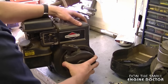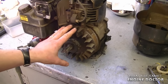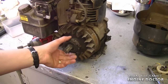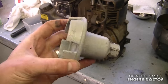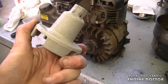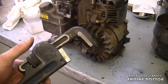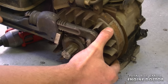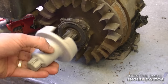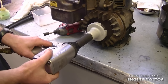Now the recoil should come off. The next thing that needs to be removed is the flywheel and the starter clutch. To remove the starter clutch I have this Briggs and Stratton tool — I'll put a link under the video to where you can buy one online. If you don't have this tool you can use a large pipe wrench on the starter clutch, but you will have to hold the flywheel. It's much easier with this tool — you just put it on, it fits perfectly, and what works great with it is an impact wrench.